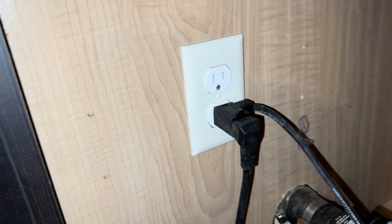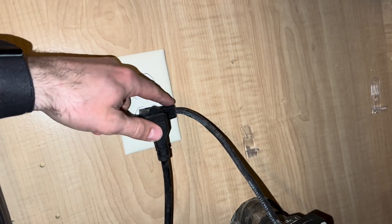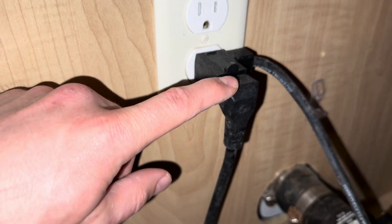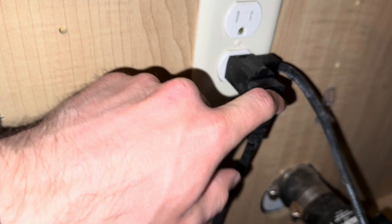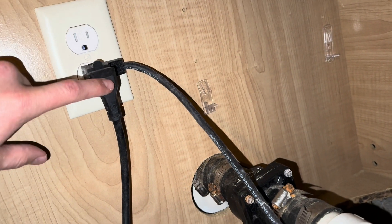This particular model has a tethered switch. There are two different lines: one goes down into the float to measure the water height and decide when to turn the motor on, and the second one is plugged into the motor. The circuit won't complete from the wall to this outlet unless the float detects that the water's high enough — that tells the motor to turn on, the motor runs, and then it shuts off and loses power.